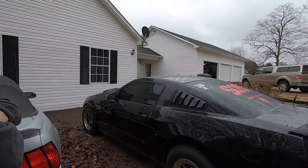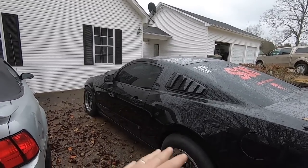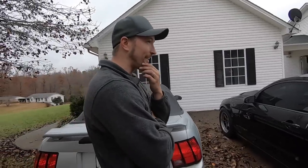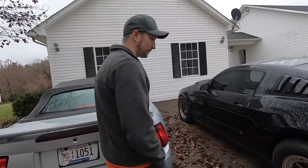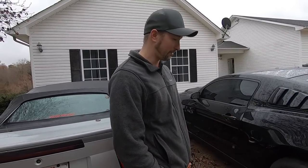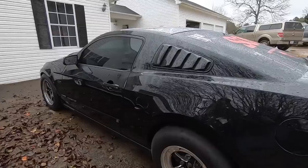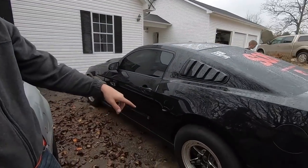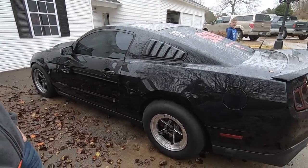Okay, so he went to 5/8 studs, and it just so happened that the S71 Weld wheels fit 5/8 studs. Big shout out to Weld for thinking ahead on that also. I'm a believer in Weld now, just from that. Start out with a half inch stud on a normal car, you want to upgrade, you don't have to change it. On the S71s you don't have to change it because you have a shank, but on these, they fit. And of course, the fronts fit with no issue. He's got the stock fronts. We're on half inch by 20 on the Shelby, and they're fitting 5/8. That's just crazy, man. Let's fire it up.